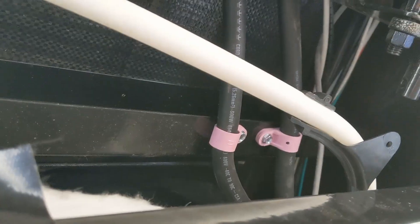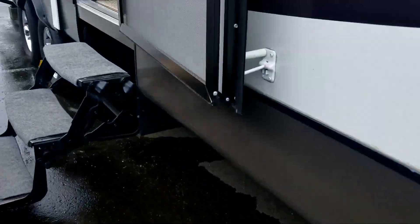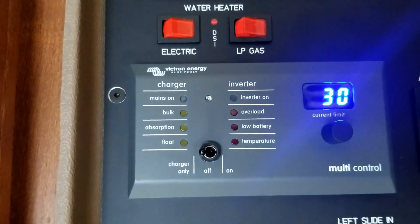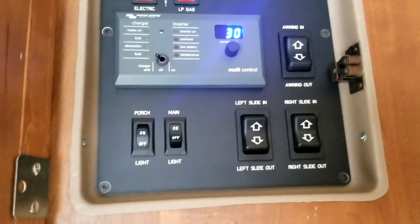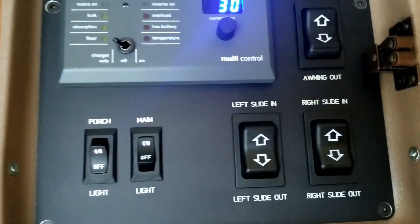Current progress: I got those wires routed and the network cables routed out of that hole, up over and inside. I tied up a couple extra zip ties on these wires — they never had any ties to start with. You can see the wires routed through there, all the way down, with a couple more clamps. I tied all the wires along with the network cables for the inverter, running all the way over to the back where it goes up top. I put the panel on a little bit — the only thing left now is to put the panel back on and deal with the inside.